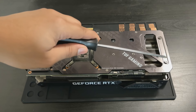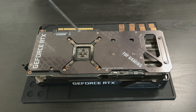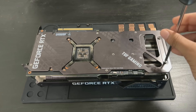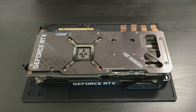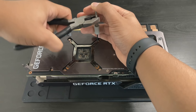The first step is removing the screws to get the back plate off. We're going to start with these four screws right here because those go directly into the heat sink and through the PCB, then we'll make our way to the cross plate and take out the remaining screws, and the GPU should just come right apart. The actual process for taking apart your specific GPU may differ significantly depending on its model — if you're unsure, look up your GPU name followed by 'teardown' and you should find a good tutorial. If you have trouble getting enough torque on the screws, you can go with the pliers and screwdriver technique — push down and twist.